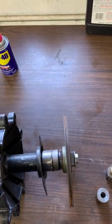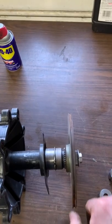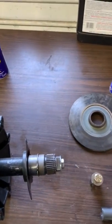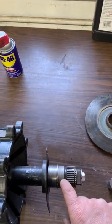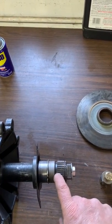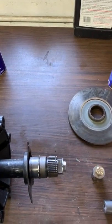On newer sleds it's going to be a tighter fit, and what we've been finding is if it's a tighter spline tolerance on a newer machine, the expansion that's occurring in here is traveling out just enough to slightly expand these splines as well, and in turn the rotor is getting tight.